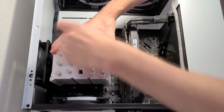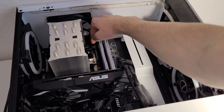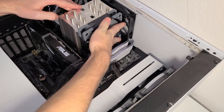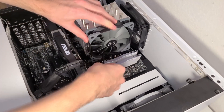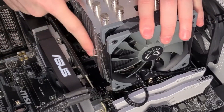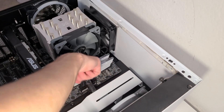Once it's in its proper position, you can start screwing it in. Don't fully screw in one screw at a time — what you want to do is alternate between the two. So screw in the left one a little bit, then the right, and keep alternating until it's fully screwed in place. Last but not least, the fan. Start out by plugging in the CPU fan cable. In this specific board, which is the B450 Tomahawk Max, the header is in the top section of the motherboard. Then you can align the fan with the CPU heatsink — there are two little notches that it slides into, so you'll know if you put it in correctly. The last step is to secure the fan in place using the two metal clips, then put them into the two little holes on the 120mm fan and slide the notch into the inlet on the heatsink. Repeat the process on the other side. For aesthetic reasons, take the CPU cable and tuck it under the fan — this will also prevent the cable from touching the fan blades, which is a big no-no.